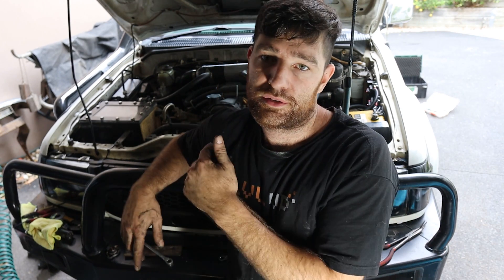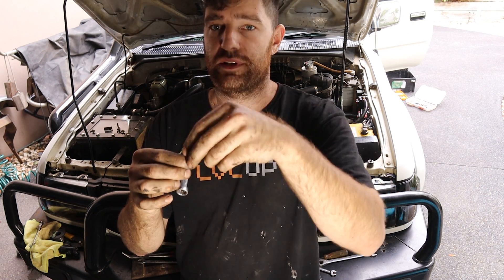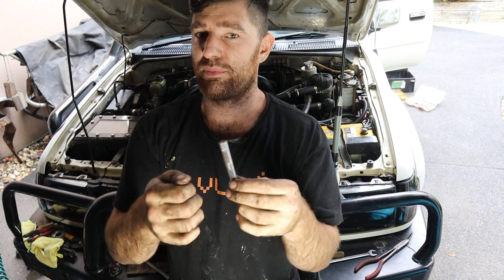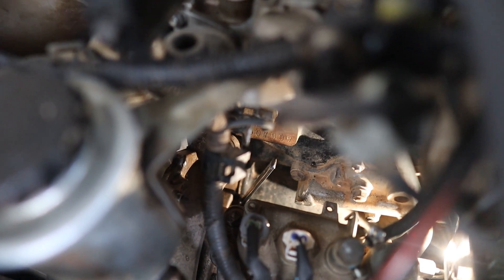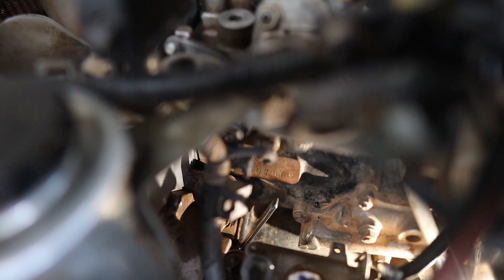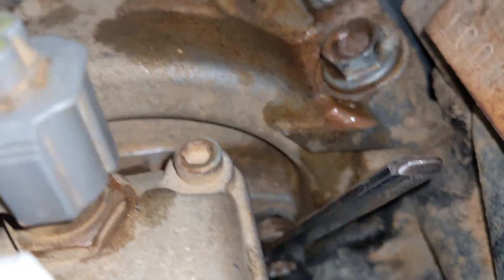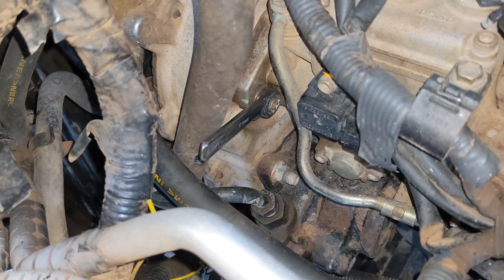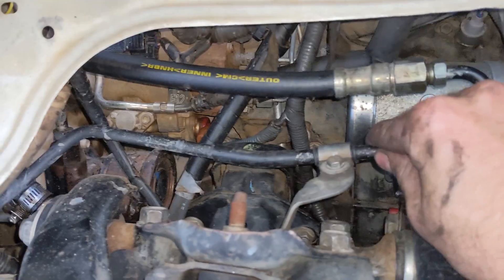There's one thing to show you on an engine that's not in the car, but I'll show you on this engine as well. Last time I did this, I had this spanner cut in half laying around and I had to manipulate it. I've got this half 12mm here — I had to grab it with pliers and crack it loose because the engine's in the car and it's all a bit awkward. As you can see, I've got that half spanner on that really difficult nut all the way down in there. If you're working on a Hilux like me, you might want to move this power steering line just so you can get to that bracket all the way down in here.